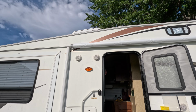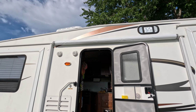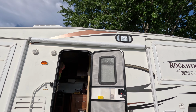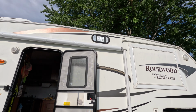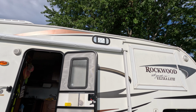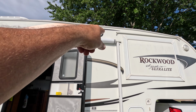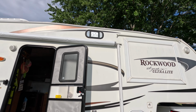So what I'll do is I'll roll it all the way out, and then I'll slide that awning at the top and the bottom, and I'll get it centered perfectly, and then I'll roll it up a couple more times, make sure everything's good. And at the end of the day, I'd say we got a success here, and I will finalize it by putting in them 1/4" screws on the top of that rail, and that key, and you saw how easy that awning slides back and forth. So once I get it all centered up, then I'll put them 1/4" screws in, one at each end at the top, and then I'll roll it all the way out, and I'll put one at each end where the awning attaches in, clear out here at the roll.